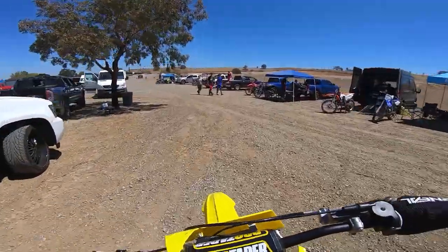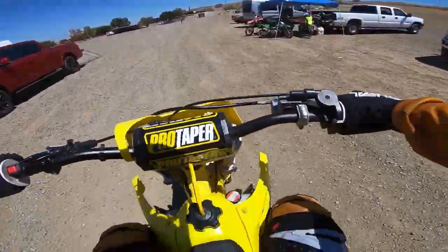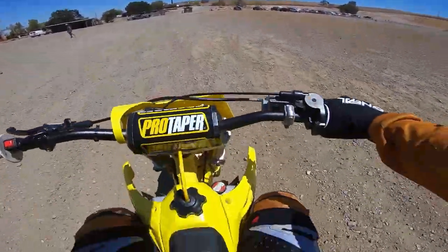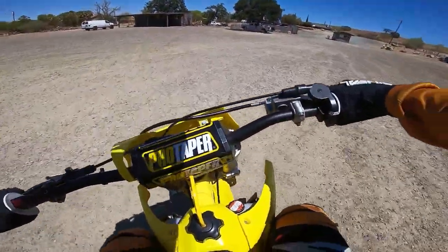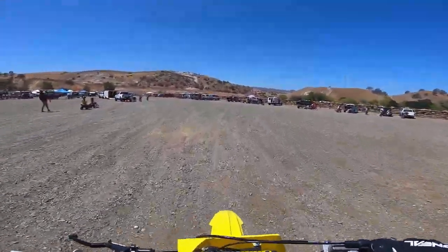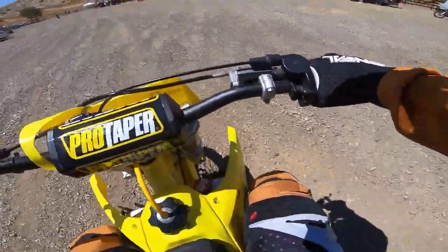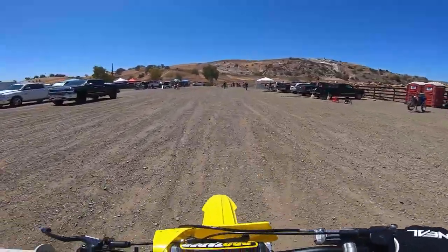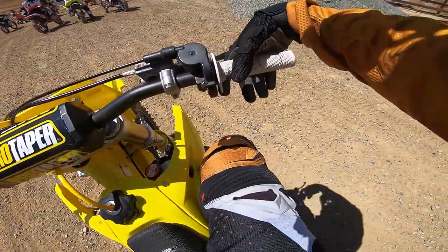So this feels very, very crisp. Bike's a little warmer. It actually feels like it cleaned up. By feel, it feels like it cleaned up a little bit of richness on the bottom end from the stock Keihin carburetor, which, in my opinion, was pretty much spot on. I couldn't get it better than that ever. So far, so good. So far, it has a good, brisk tug off the bottom end, which is, I'll go ahead and say that's an improvement over the older Lectron carburetor, where they tended to be a little more soft on the bottom. Let's go ride this bad boy. Throttle's a little on the tight side, the cable. That's okay.